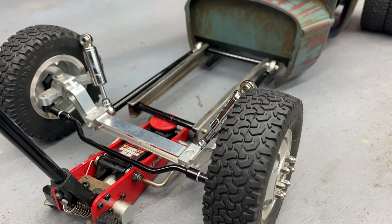So typically when I build these, I just kind of focus on one thing at a time. First we get the look, the body, the wheel and tire, the stance that we want. Then we'll make the chassis to fit it, and then we'll start looking at how the rear suspension is going to hang. The front is still completely up in the air. We can lengthen it, we can shorten it. This chassis wasn't built with a complete image in mind, which is usually the point I like to do it at, because I don't know what motor or anything we're going to use on this. This build is kind of a mess, so we'll just play it by ear.